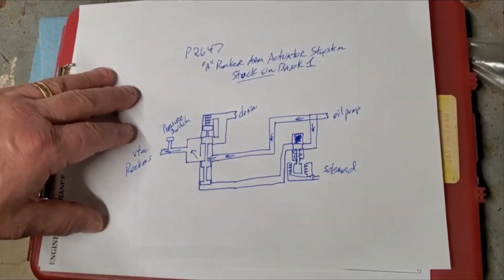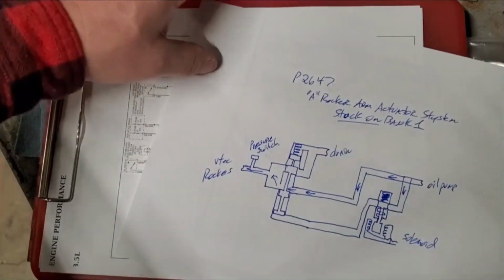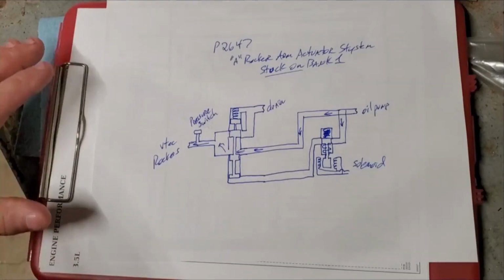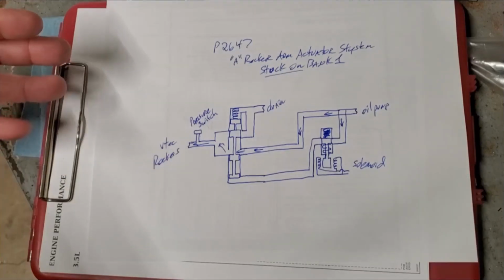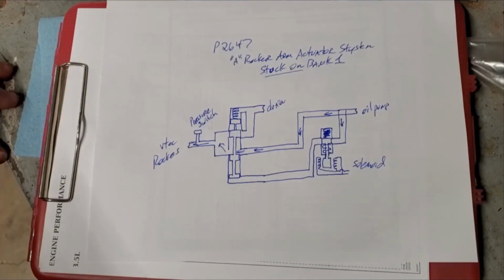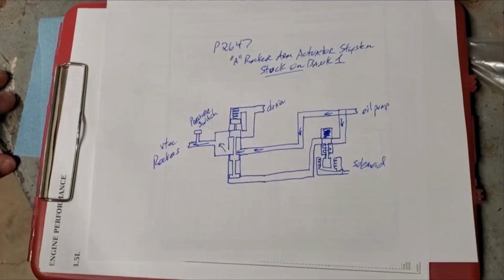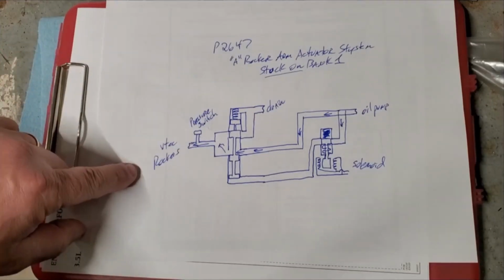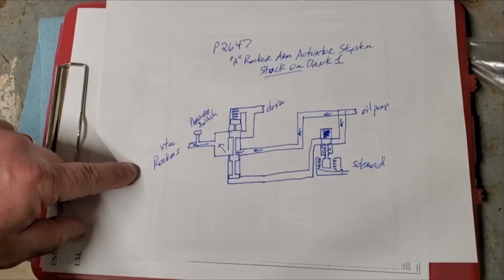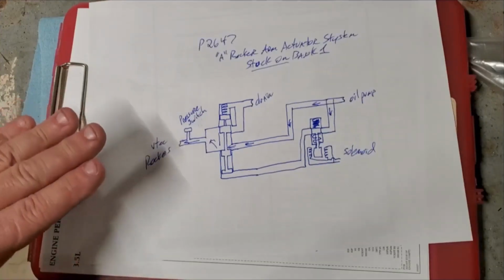Now, on my 05 Pilot, it's a different animal when it comes to this. It's in a different spot and all that, but what I'm getting at is that you just drive it normally and the engine is not running under VTEC. But boy, you hit that 2500 and you're wide open, you can hear the intake change. It goes wee, so you know you've got more lift and duration, and it sounds like a little more reversion on the intake. It's more aggressive and it hits hard. This system on the 07 Odyssey is very smooth. It doesn't do that. It's just a smooth power progression.